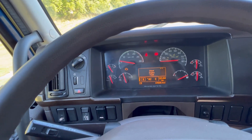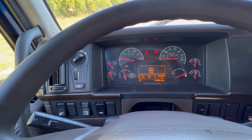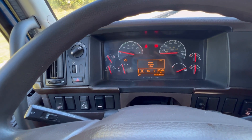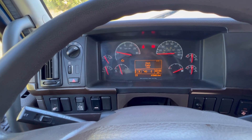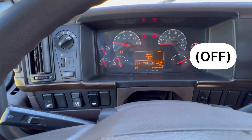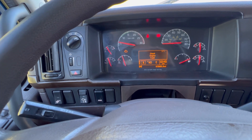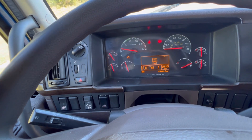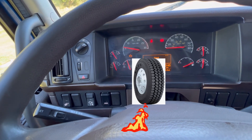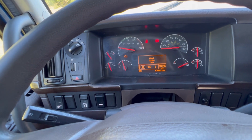I notice a lot of people don't use engine brakes. I've been in trucking just a couple of months — I'm a fairly young driver — but I like to explore, watch videos, and ask questions. If you're going to use only your service brake to stop your truck driving three or four hours, your truck is going to maybe catch fire. There's so much out there about burnt-up brake linings and trucks catching fire because people don't use the engine brake to assist them. The engine brake is there to assist you — don't worry about using it too much, that's what it's there for.